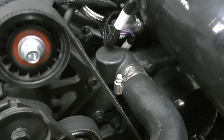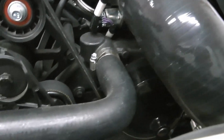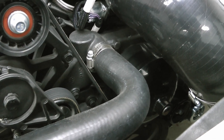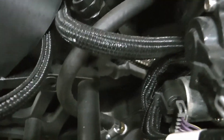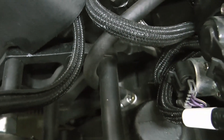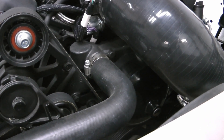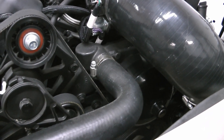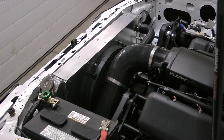The water pump is a 98 Camaro LS1 unit. Because I'm running a truck-spacing crank pulley, I've got some 3/4-inch spacers on it. This pump with the spacers allows you to put the steam tube in, and it's also way cheaper than a pump with built-in spacers. The steam tube goes right into the spacer. You can get a style pump with the spacer already built in, but this was the cheapest option at the time and did exactly what I needed.